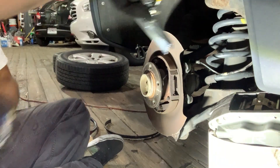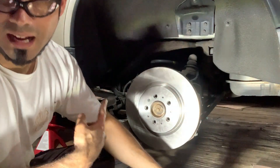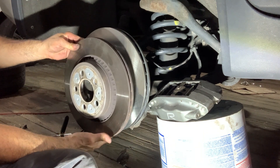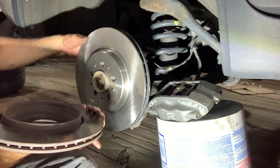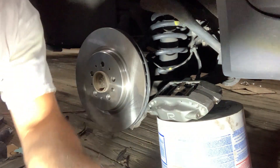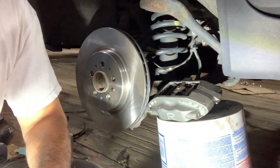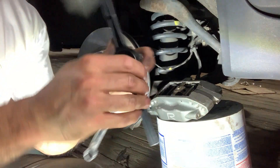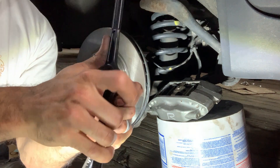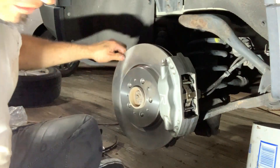Make sure this is all straight. You can buy replacement dust shields. So these are the stock XC90 brakes — they're quite a bit smaller if you line up the bottom half. The emergency brake rides in here, all that's the same, so your e-brake should all work. Now before I put the caliper bolts in — they're pretty crusty — I have an M10 by 1.5 die, so I'm going to clean up the threads so it goes into the caliper easy and doesn't damage it. That's the before and after — that's why we do it. About done with the back brakes.